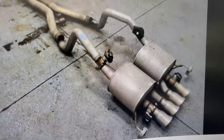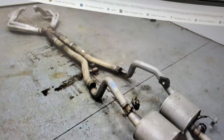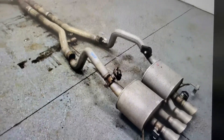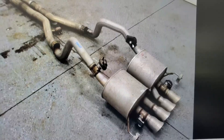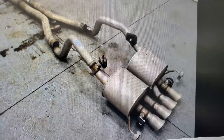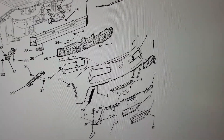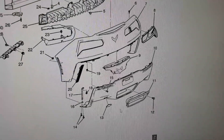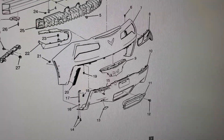Here you can see the valve after and the valve before. According to the code, it's the right side valve that's defective on mine. In order to fix it, I'm going to have to take the whole exhaust off so I can work on it and take just this little piece out — there's no room to do it with the exhaust installed. To take the exhaust out, I'm going to have to remove the rear bumper in this area so I can have access to the exhaust. I'll show you everything I need to do and then get started.